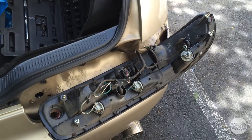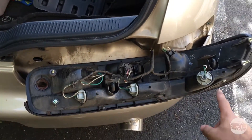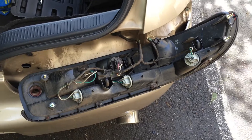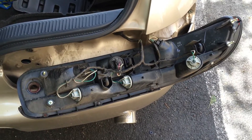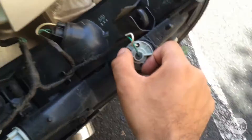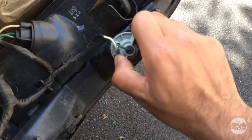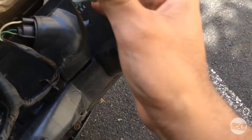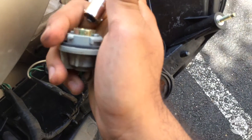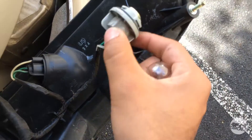After you remove the tail light from the bumper, the bulbs you're going to be replacing are these three — one, two and three at the top for this particular car. They are all type 1156, and all you need to do to remove these bulbs from their housings is righty-tighty lefty-loosey them. You pull them out like this, and then same thing with the bulb — push down and then pull out, and then you can replace them with your LEDs.